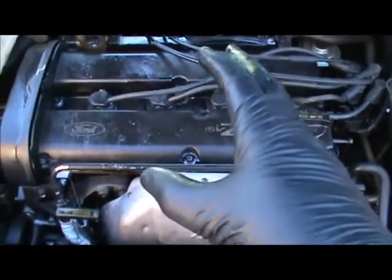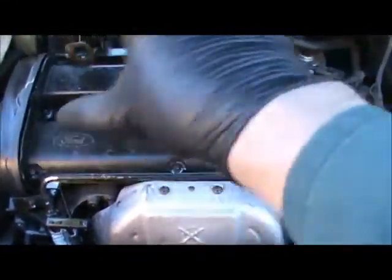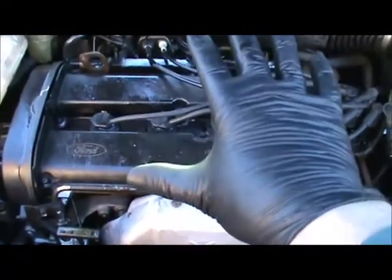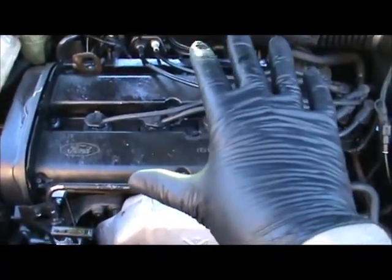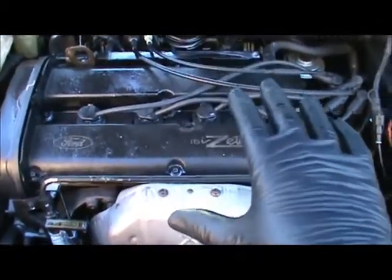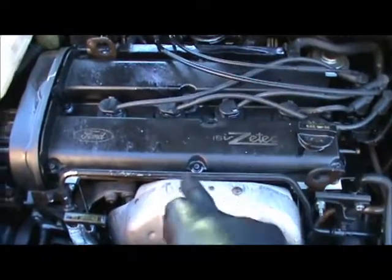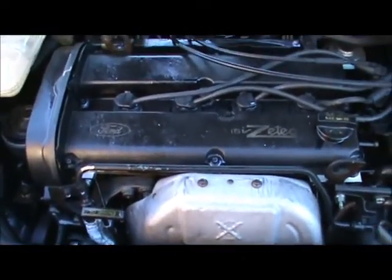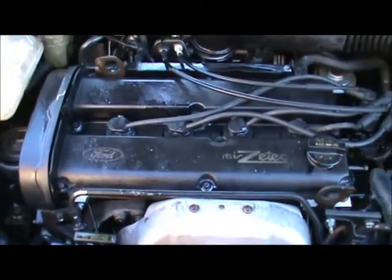You want to give it about 4 or 5 minutes. I wouldn't have it in the sun at all. I wouldn't want to let it dry on it. So just make sure, however long you're doing it, don't let it dry on the engine. Just make sure it's like this, where it's still a little bit moist, and maybe 5 minutes at the most. Let it sit.